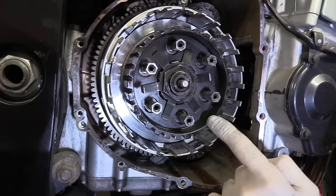It makes it quite clear. This is the Gecko clutch unit I got from Wemoto. It makes it quite clear on the rear. Gecko clutch friction plates are manufactured from cork-based material, similar to that of the original equipment, and we recommend that they are soaked in engine oil before installation. Says it on the tin, and also it will say it in your manual as well. It's extremely important. It's a wet multi-plate clutch. It must therefore be wet. It's in the name. Okay, right, friction plate on and put the springs in.